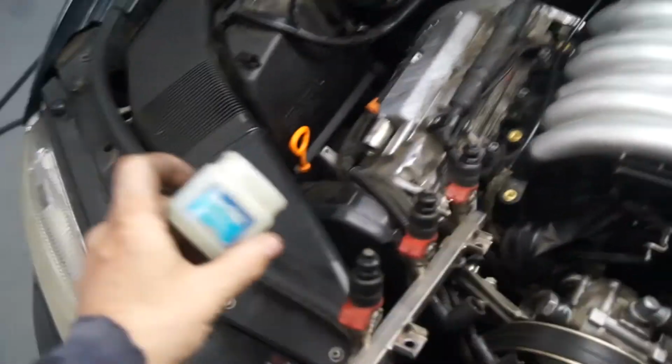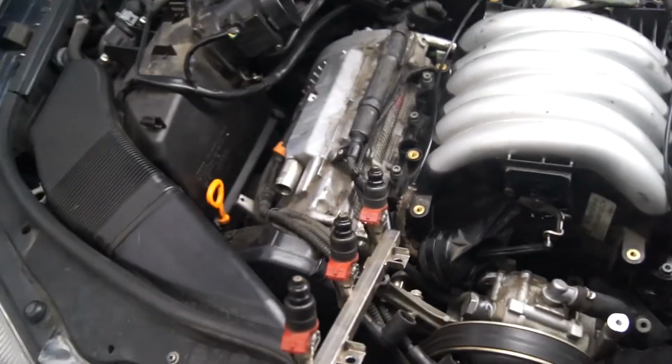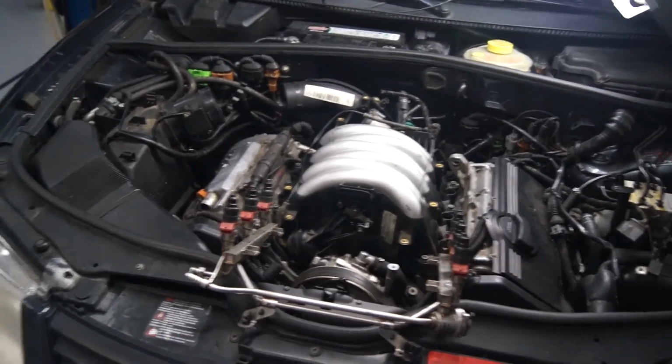Almost forgot, Vaseline on O-rings, it's the right thing to do. Slips right in there, helps them slide in. I'm almost out, but yeah, just on those O-rings, put a little Vaseline, and it makes them slide right in, and it makes your life a lot easier when you're seating these things. Plus you don't pinch one, catching on some dry spot or something.